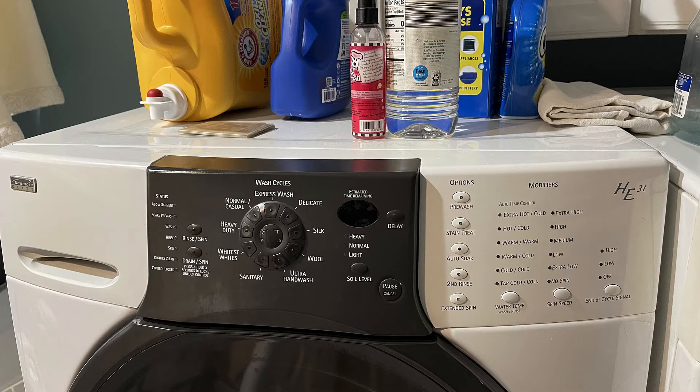Right now I have no screen. If you press one of the buttons it will actually light up, the numbers would light up, and then you go to hit start and it would go blank. My wife also said it gave an F error code, which is typically pump not working or things like that.